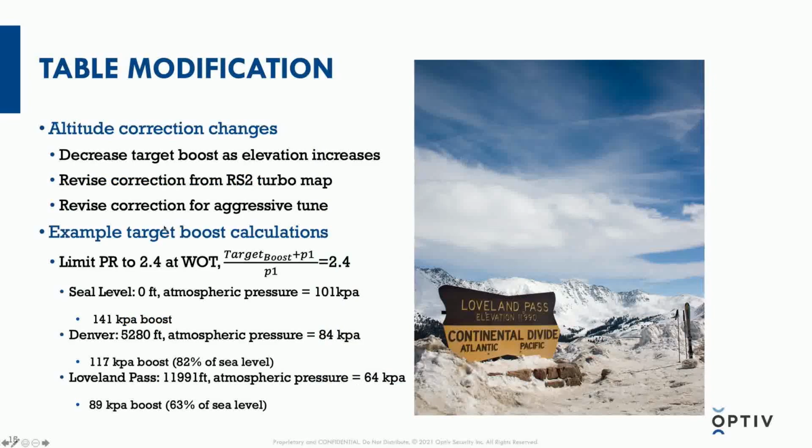So essentially, for the modifications, since I was able to reverse engineer how the program retrieves data from the sensor, then passes it to the turbocharger control program, then looks up the table values, I was able to figure out where the table axes were and the table values themselves. From that, I was able to plug it into a more easy graphical user interface where I could modify those values. And through an analysis of multiple data points, I was able to figure out what a reasonable correction factor was for those values in real-world numbers versus hex numbers. In doing that, I could finally modify these altitude correction parameters.